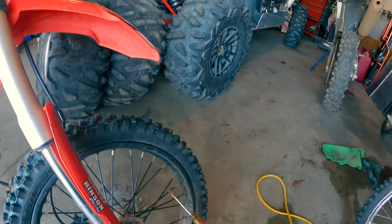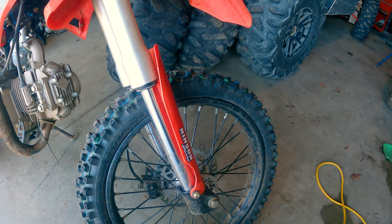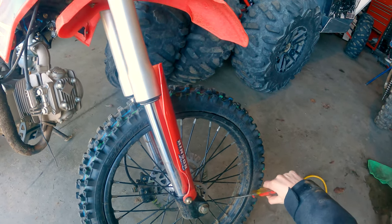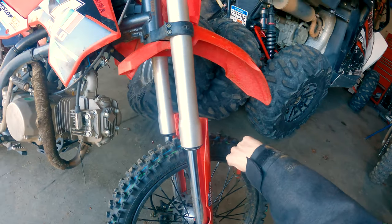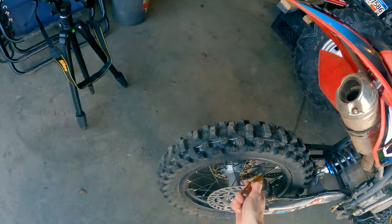The second thing to check on your tires is the spokes. The most common cause for spokes becoming loose is uneven tension around the wheel. If your spokes are so loose that they rattle, they're providing virtually no strength to the wheel structure and you're likely to taco a rim, get a pinch flat, or destroy other parts. To quickly test if your spokes are tight, run a piece of metal along them like a harp and listen for different pitches. You can tighten them with a spoke wrench or a small adjustable spanner — I highly recommend picking up a spoke wrench, linked in the description.